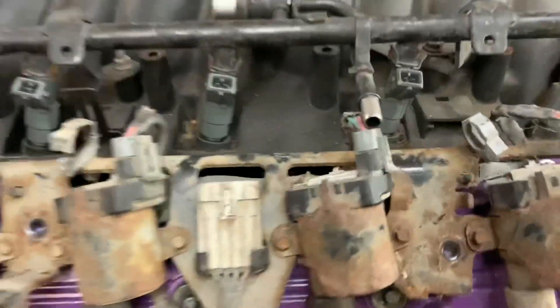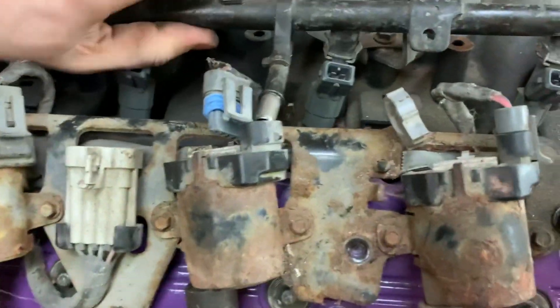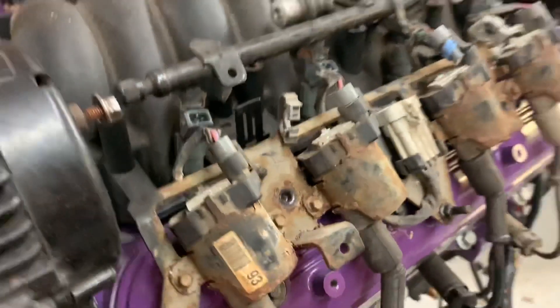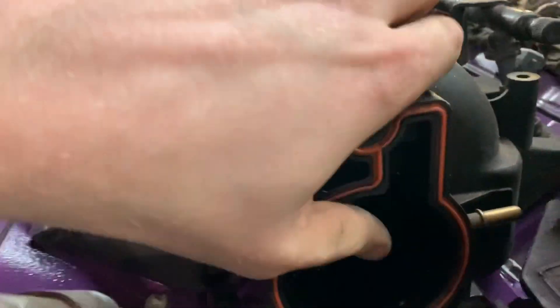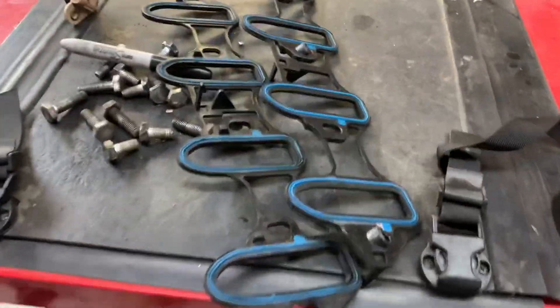Found what was hitting - it's right here. This coil plug-in, you can see, is stopping it from sitting where it needs to. If I just unplug this it goes down almost flush. It's still hitting the coil over here, so if I unscrew this coil it'll sit flush. It doesn't have separate gaskets like the truck - it has O-rings, so I'm gonna set an O-ring in.